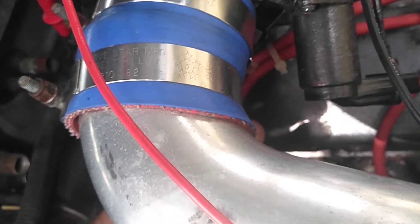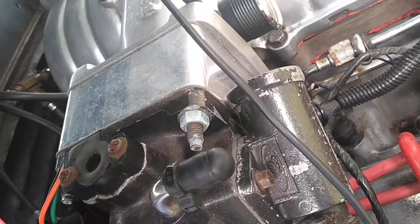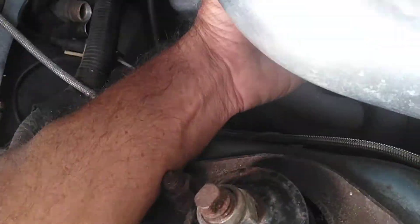I got it ohmed out. So once again, as you can see, I got my hand down there at the throttle body. I have it in the green wire, and I have it grounded out to the intake. So I'm going back and doing it again, opening it up. Gradually it should open, but it doesn't go to 5 volts — so it's out of range, in my opinion.